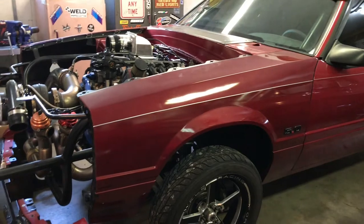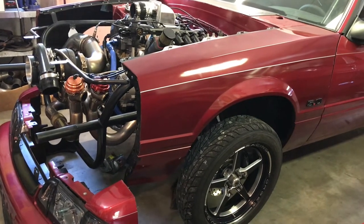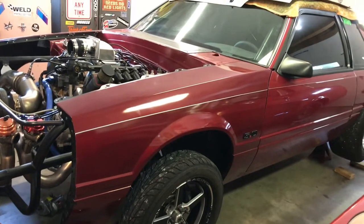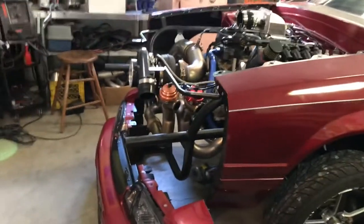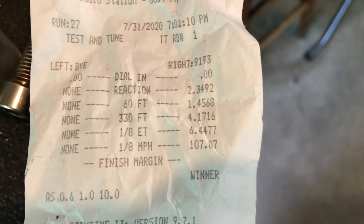So I looked at the tune - it was kind of fat. I took some fuel out. With the methanol injection that I put on it, it was really tuned for that high 20 pounds of boost that I kind of had it street tuned for. So when I turned the boost down, obviously you're getting less air but the same amount of fuel, so it was hella rich. Rich is not good for power - you know the saying, lean is mean. Anyway, we upped the boost to 20 pounds. I actually kind of peaked at like 22 and then fell. The fucker went a 6.40 with a horrible 60-foot - just a horrible fucking pass in general.